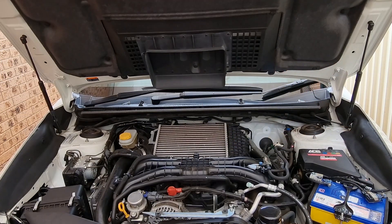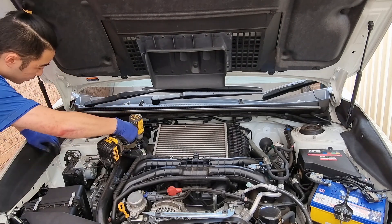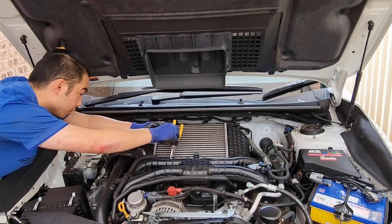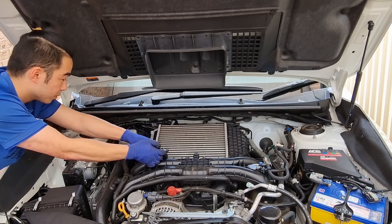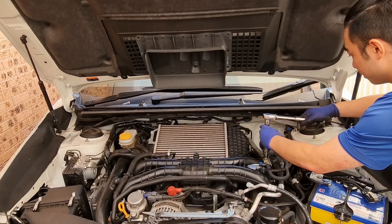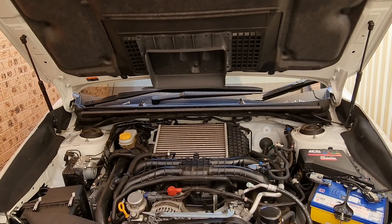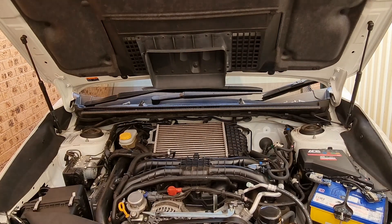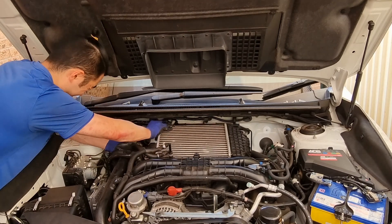Let's get this off and see how we go. Intercoolers are essential for turbocharged and supercharged engines. The purpose of an intercooler is to reduce the intake charged air temperature. Cold air is denser than warm air — that's the simplest and most important application of the particle theory of matter. You would rather have 20 psi of cold air than 20 psi of warm air, because the same volume of air when it's cold is so much denser and will carry many more oxygen particles. With an increase in oxygen delivery to the engine, it will allow you to burn more fuel and ultimately generate more power. Intake air gets compressed by the turbo, which is why it gets hot. When the hot charged air goes through the intercooler, the tubes absorb the heat and allow the air to condense and become cooler. The heat absorbed by the tubes then transfers to the fins, which dissipate the heat to the atmosphere.